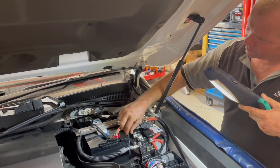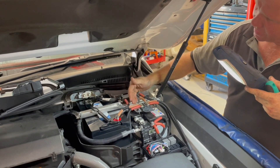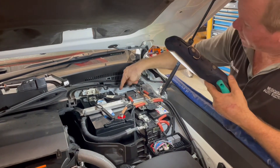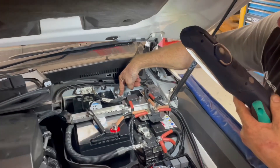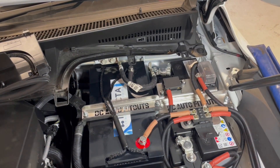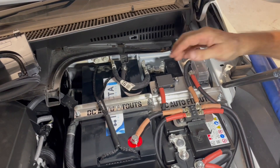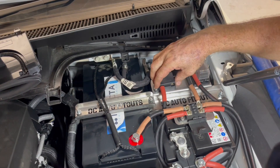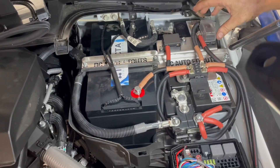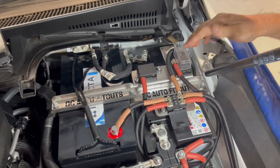You've got your main power cable which loops up and comes onto the actual stud here, and then your auxiliary floating onto the auxiliary battery there. Up the back, we link the earth — it loops up nicely with the other earth cable and comes onto the back there. This one does have the two optional fuses as well, put to the main battery — midi fuses feeding through onto the main battery, and the blade fuses going back through to the battery.